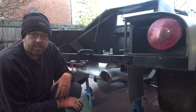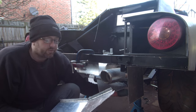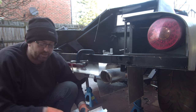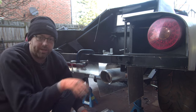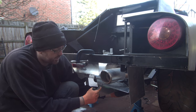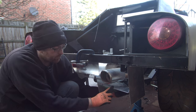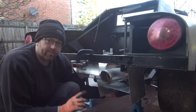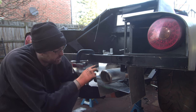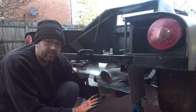It rained last night so we brought the camera inside, but we continued work on the extension pieces for the diffuser. These have a triangular section that fits onto the framework at the back and bolts in through the bottom, fitting onto the side of the main diffuser panel. The bent panel forms the actual diffuser opening at the back of the car — it'll pop-rivet onto the inside edge here and screw onto the vertical framework. We haven't yet finally set the angle on the back piece; we'll wait until it's all bolted in, then angle it to give a similar spacing around each exhaust tip and make sure both sides are even.